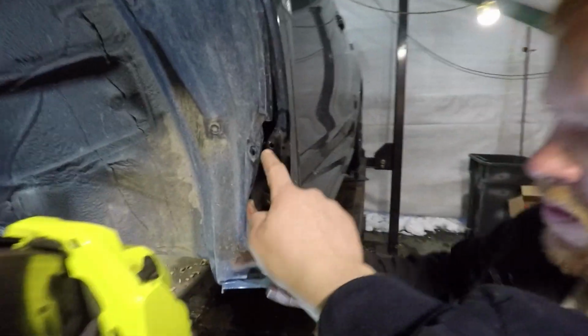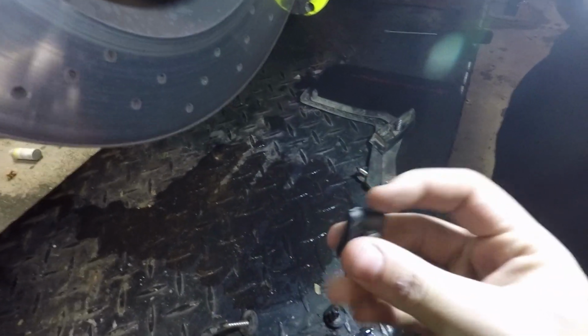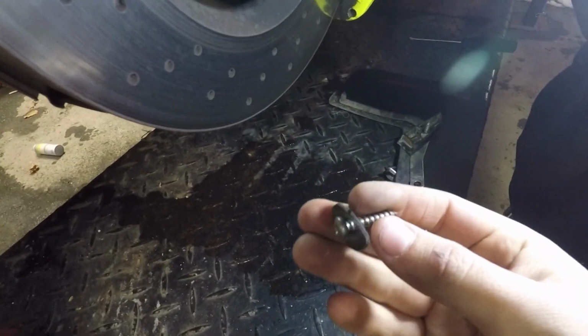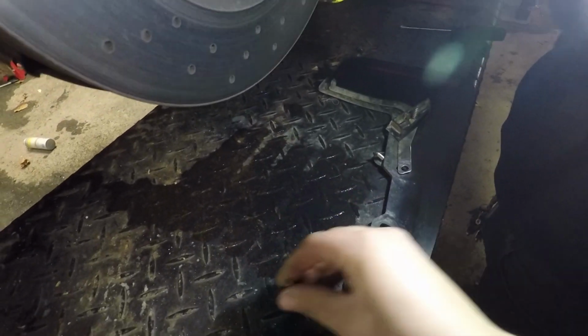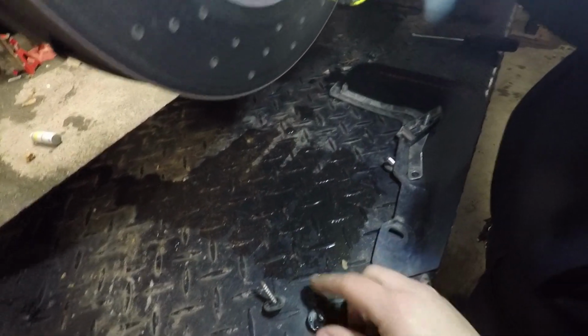It's on these little metal tabs themselves that would normally get these plastic clamps put in. Now they're going to get these clips, so that way it'll accept this machine screw, so that way they're on there a little tighter. You don't have to worry about these popping out over time.